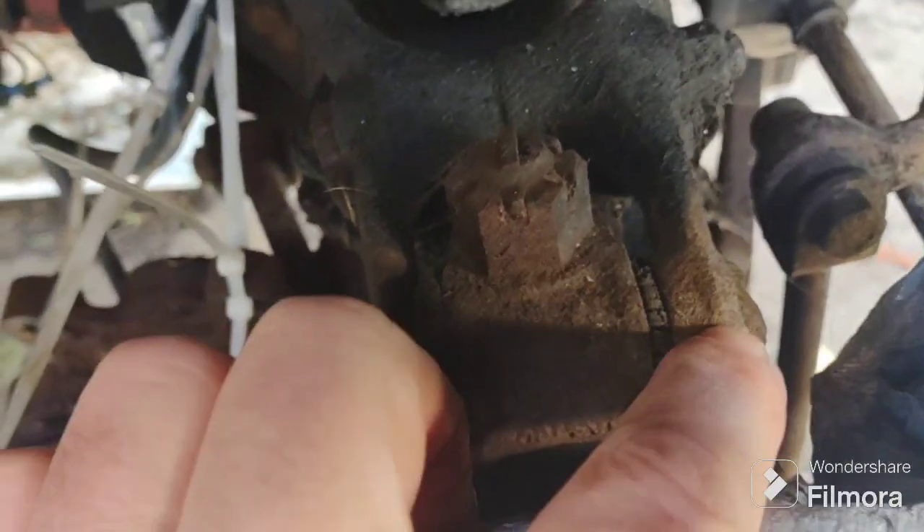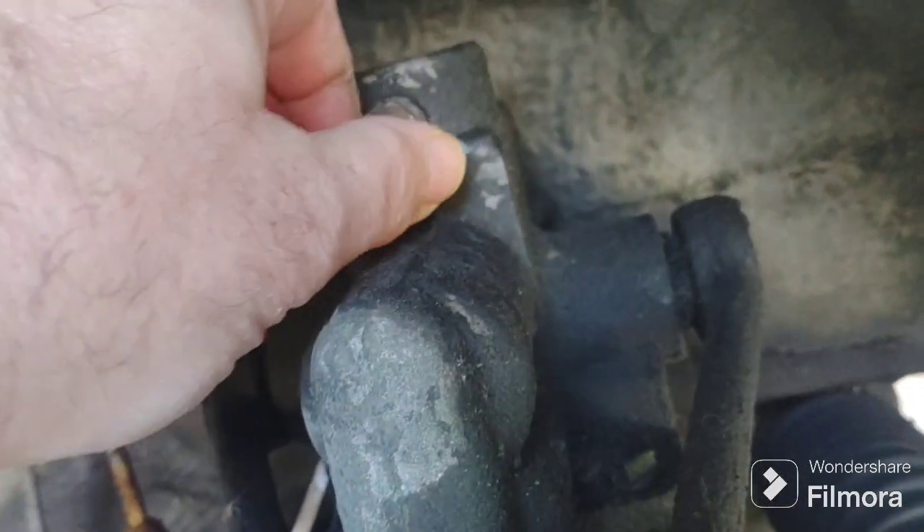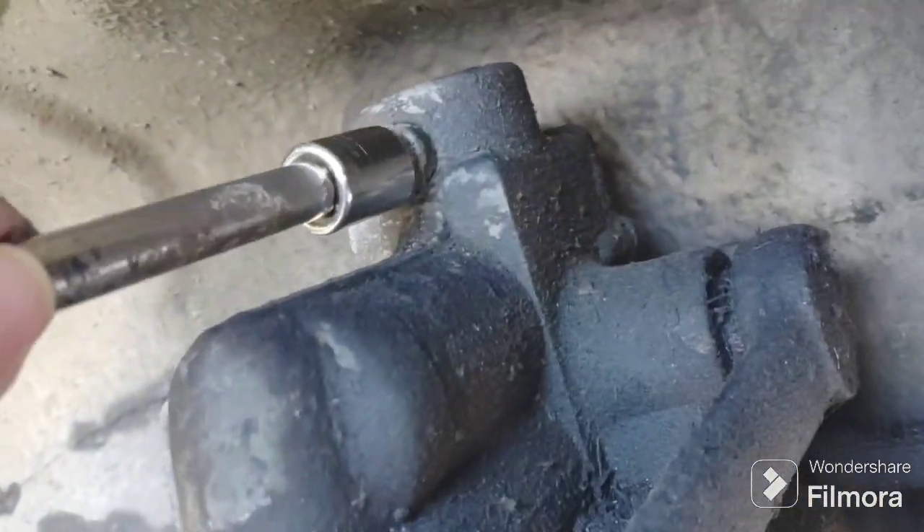These are easy to replace. You're going to do these two bushings here - one, two - take this split pin out, and then there's four bolts. See, there's the corner one there, four all around, and that's it. You support the lower control arm with a jack. I have this cover on now because I'm doing my hubs.